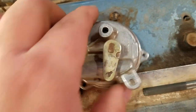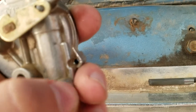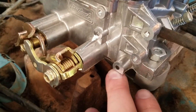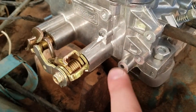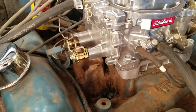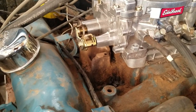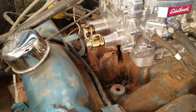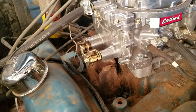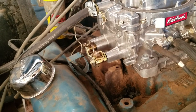On the back side, you will have a little rubber washer here — make sure it's in place, because you need to have it seal up tight against this right here, because that is the vacuum port. I'm going to put that on now. In the interest of saving time, I'll pause this video, put this on, and get right back to you.